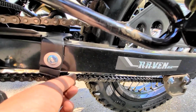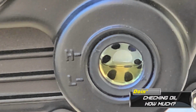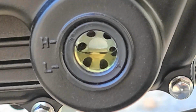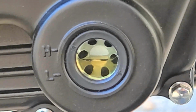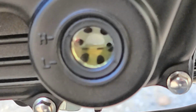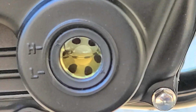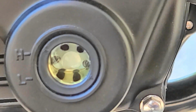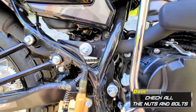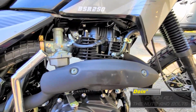It should have a hair more slack. The sight glass is how you check the oil. The bike has to be off the kickstand and level. That is the proper level. When you change the oil, it is exactly 1 quart. That is it. It's good from there, which I'm leaning the bike towards me, to there, because that's the high and the low mark.